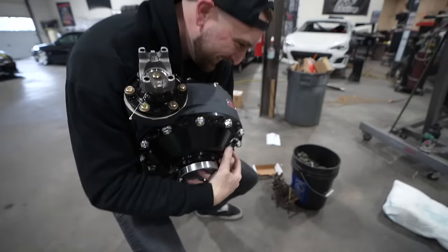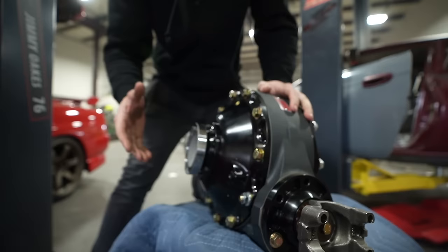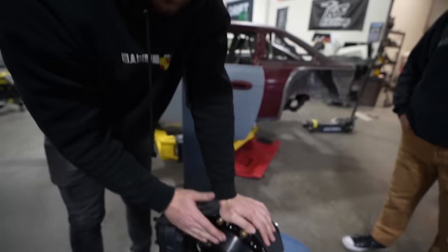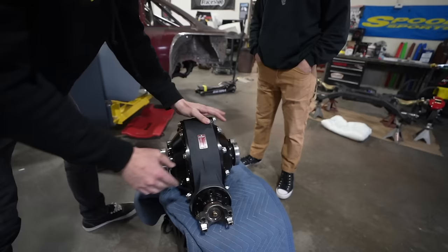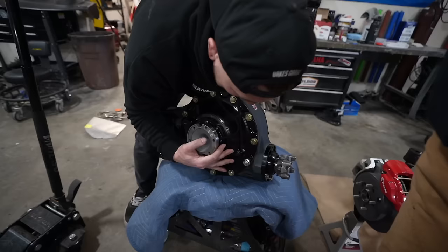The mounting points for this diff utilize three of the front casing bolts and then two bolts on each side and two in the back. All that power being held right there shows how important it is to have strong side casings — if these twist, things are going to break. Having billet casings on a diff like this is huge. The Bulldog really gets the win on that one because of the quality and rigidity of the side casings alone, plus all the extra bracing inside the main casting. This ain't no R200.